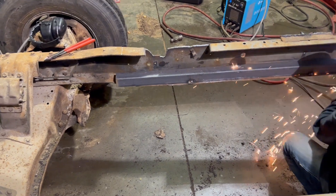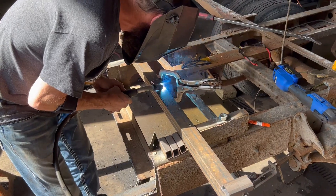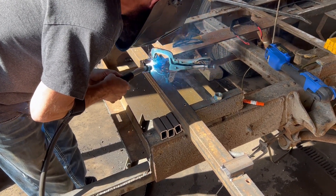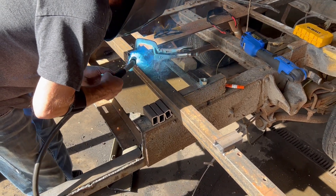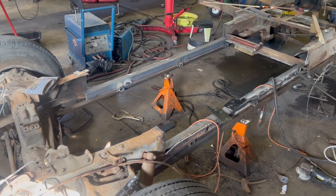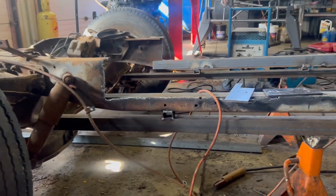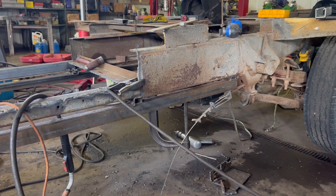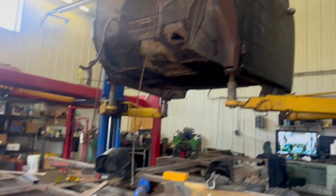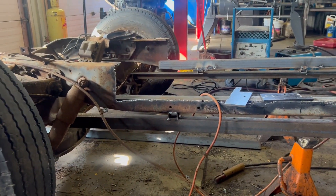That's the rectangular iron inside, and then we cut the top of the frame off with a plasma cutter. We have the frame notched for the cab to fit in, and we added a second rail underneath the original frame that'll be tied in to give us our strength back from the notch we took out. This will allow the cab to sit right down into it, and it'll probably cause some problems for us with the fenders, but we'll figure that out too.